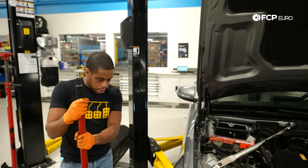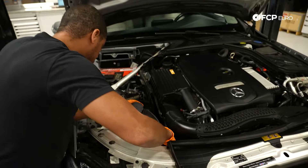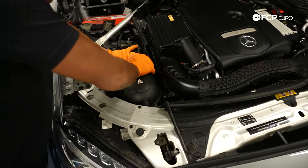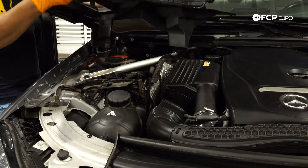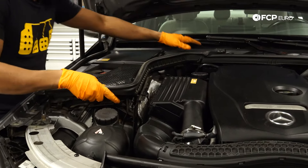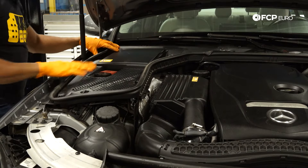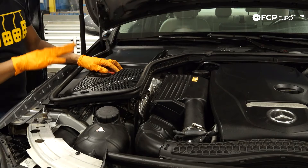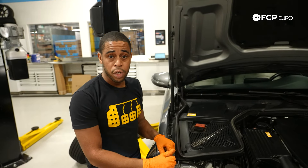Moving the floor jack as it's no longer needed. We're going to clip the coolant reservoir back in — one clip over here in the rear and two rubber grommets that it floats in. Now we're going to put our cowl back on. The cowl is snapped back in place with the locking fasteners around the perimeter — all locked up. We're done with under the hood. Now we're going to torque our sway bar end link and torque the strut assembly to the spring control arm, and that's a wrap.